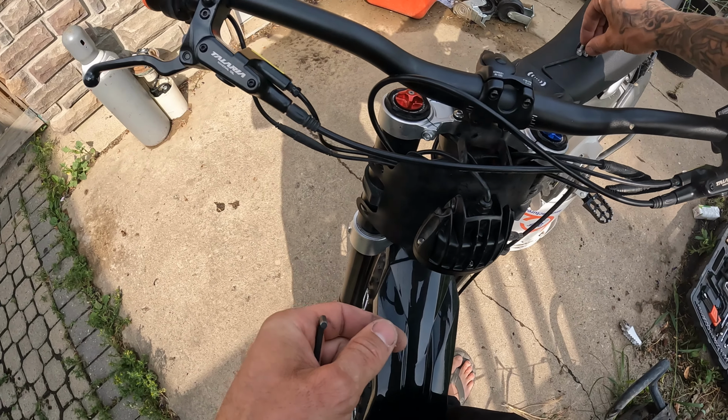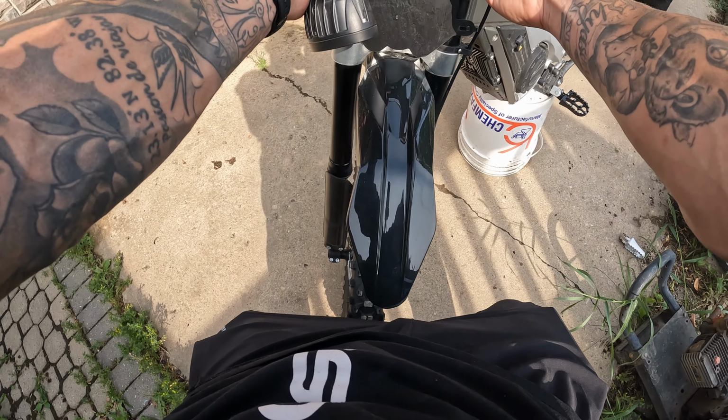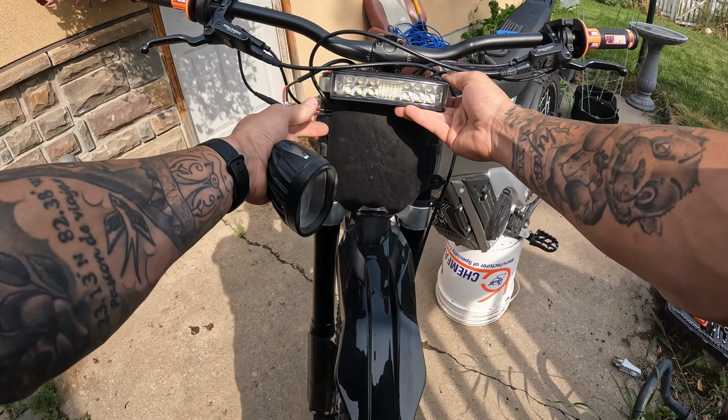what we're gonna have to do is wire this plug onto this aftermarket headlight off of the stock headlight. So if you go to the connector, push right here, that pops out, boom. And there, so now what we gotta do is keep this connector, cut it off of the stock headlight, and then we will solder that connector onto this headlight, and that should mount right there, giving us that look. Like that.